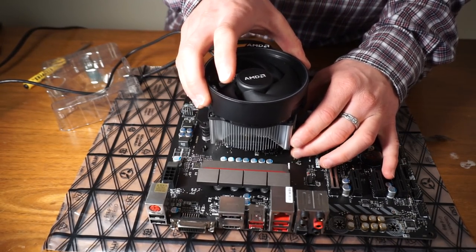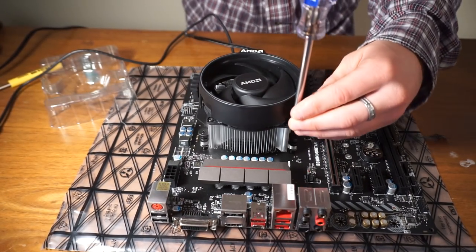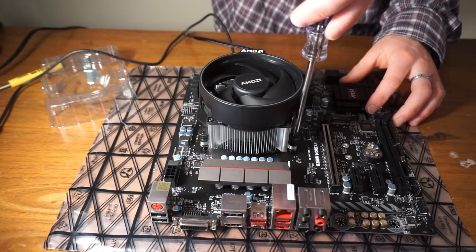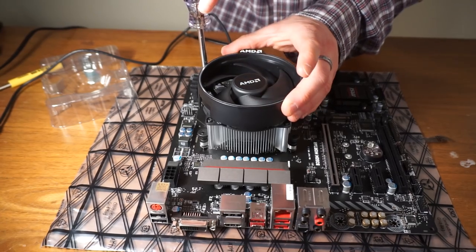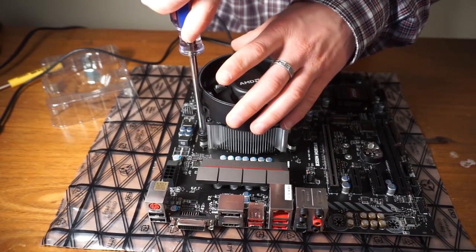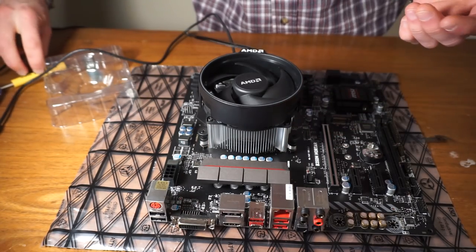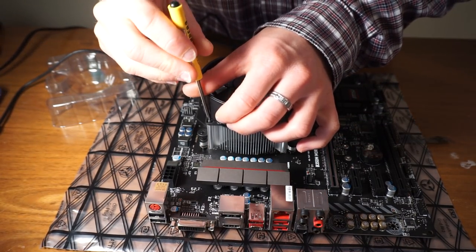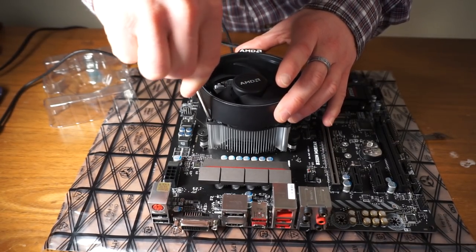So that's what I'm going to show you how to do today. First thing we're going to need to do is actually mount it. I can't help but notice how many people are doing Ryzen builds and griping that the heatsink is crooked like this. And today we're going to solve that very simply. These pegs are rectangular, but these are square, so can't we just take these screws out on the fan and turn the fan around? So that's what we're going to do today.